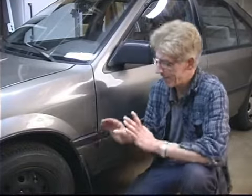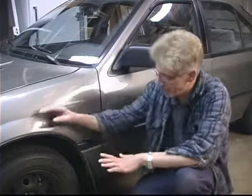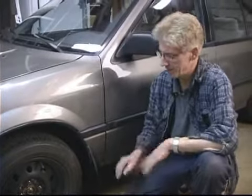You've got a couple of different options for how you put the chains on. If you're stuck, you'll be dealing with putting the chains on pretty much where the car is at. One thing to pay attention to while attempting to get unstuck: if you're starting to dig down and not moving anywhere, the deeper you dig that hole, the harder it's going to make applying the chains. And if you dig the hole deep enough where the body of the car contacts the snow, you'll find it extremely difficult to get a jack underneath to give you any assistance.